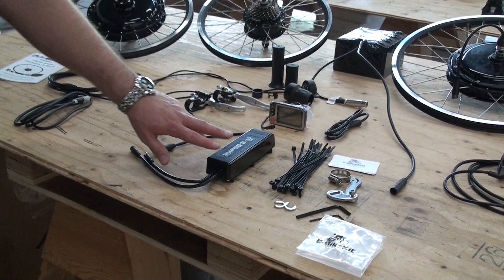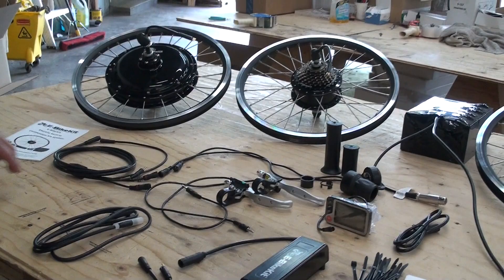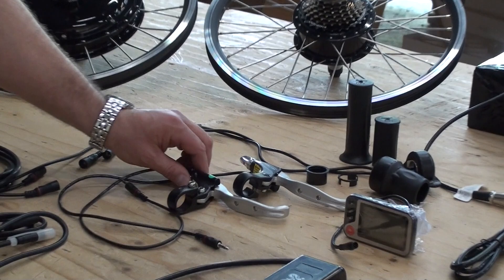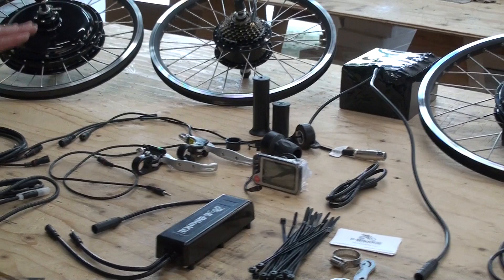The 2013 E-Bike Kit has a 12-FET controller with 22.5-amp peaks, fully enclosed and fully waterproof. This is turned on by your LCD. Here's the motor wire that runs between your controller and up to your hub motor. This is a four-way cable that runs from your controller up to the front — it ties into your Tektro e-brakes, which cut power to the motor when engaged. These replace your existing brake handles; they're high-end Tektro brakes. Those plug into your four-way, and then you have two throttles — you're only going to use one, depending on how you change gears, you'll use the one that works best for your bike.